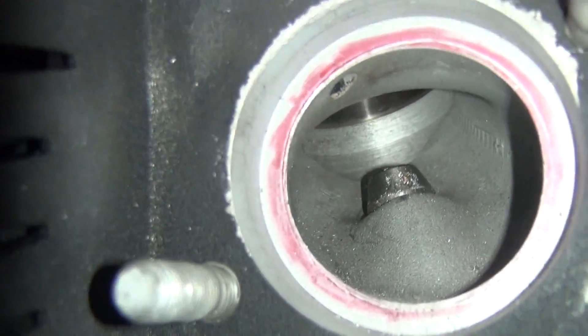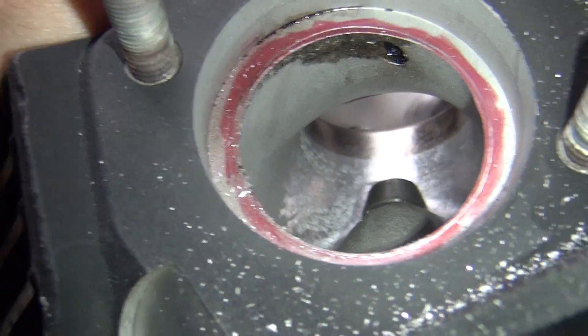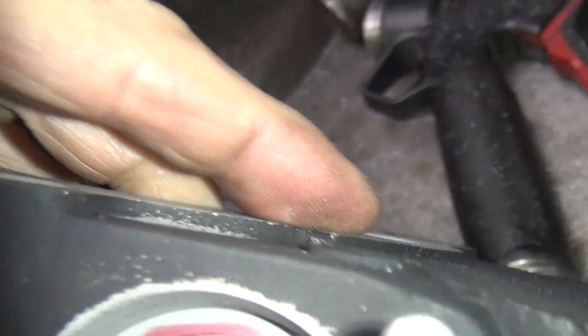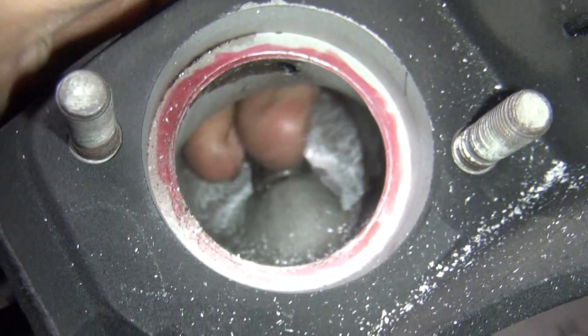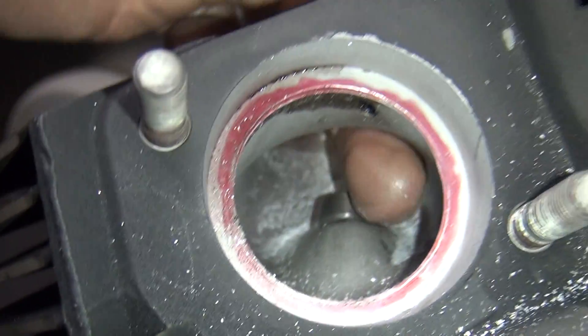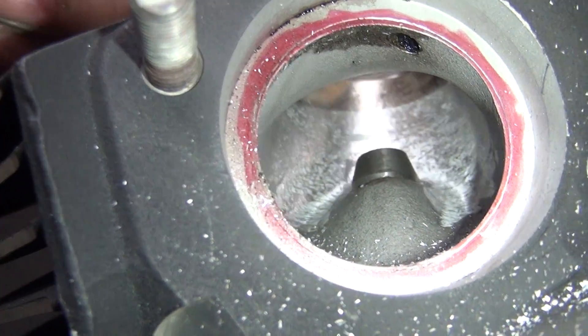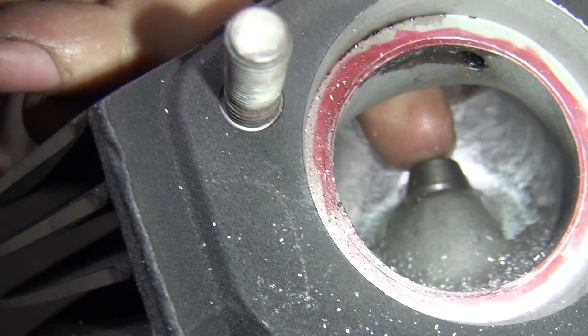This one here is pretty much the same way. You can see what it looks like initially and you can see how much you open up with this one — you can almost see the whole valve now. On this one you don't quite see all that much of the valve, quite a bit but not all of it. This is pretty square here top to bottom on our roof — perpendicular to our valve guide. It's a little bit lower through here which is higher, so I might look at that a little bit but it's pretty good the way it is.